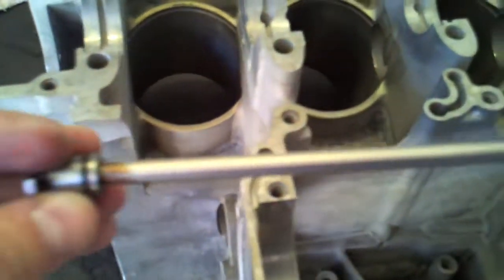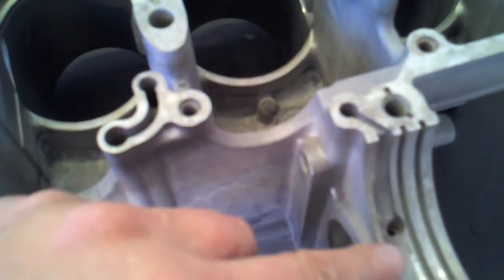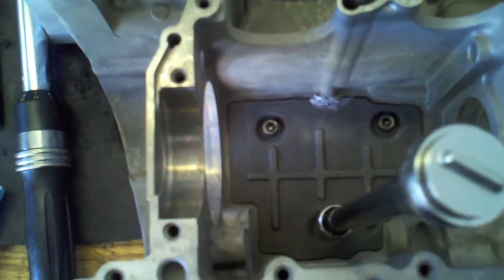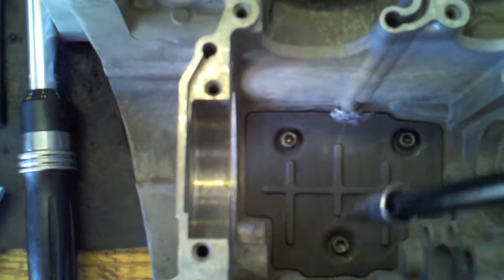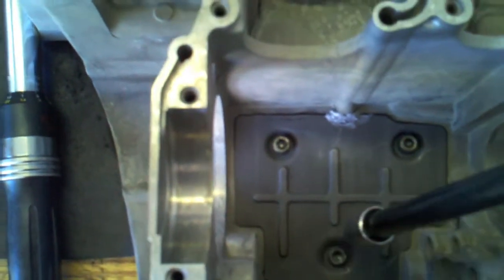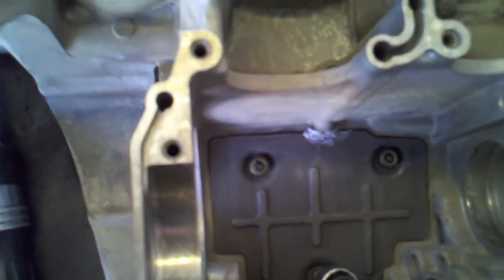I'll press-fit in the breather hose fitting from the outside, and there's a bearing I'll need to press-fit back in here. The oil pipe delivers oil back to where this bearing is — there's a port here that goes into this pipe, travels back, and then feeds down into this hole and falls back down behind this bearing. These bolts are torqued to 10 newton meters. The baffle plate prevents oil from getting up into the higher compartment, and the crankcase breather hose attaches to the outside.